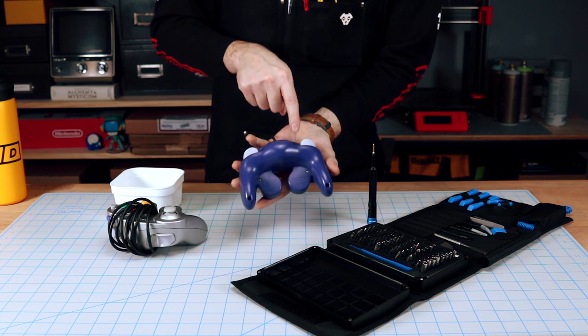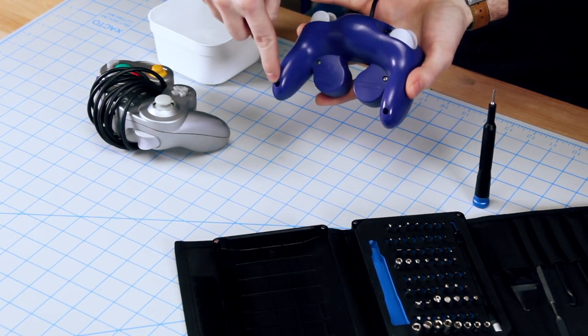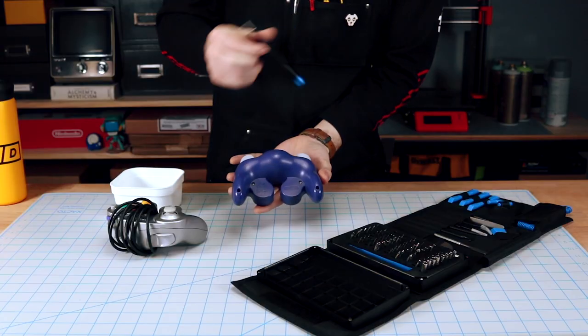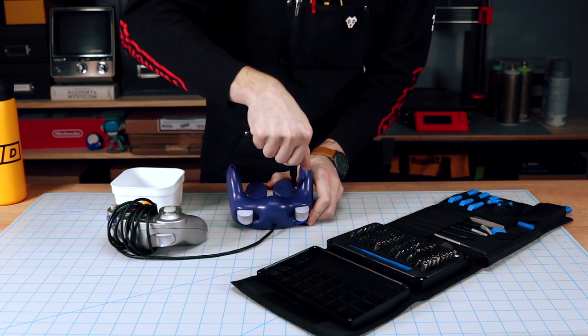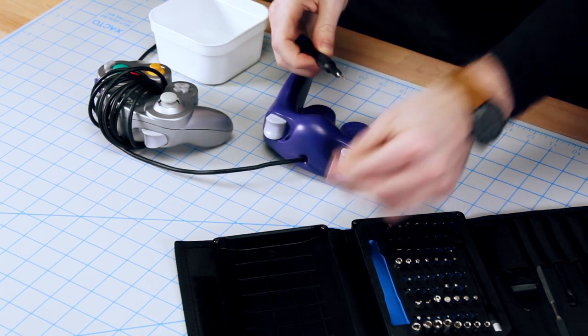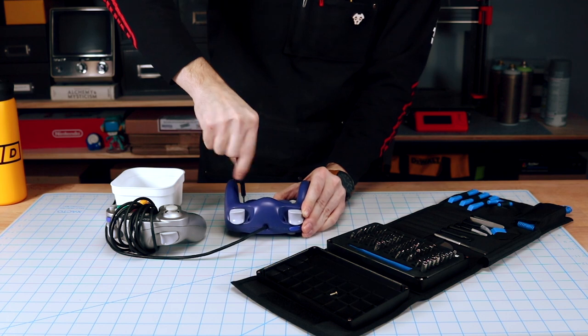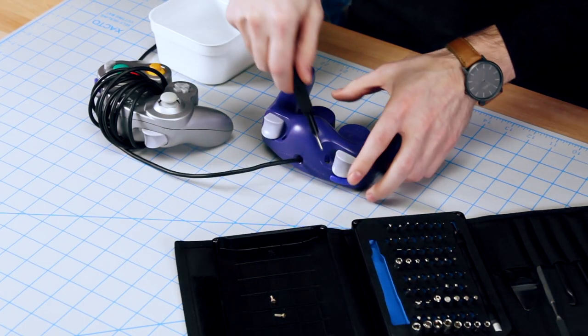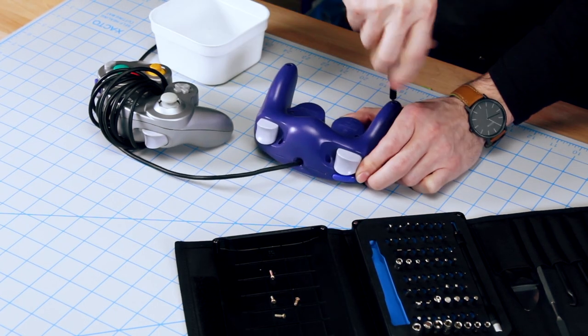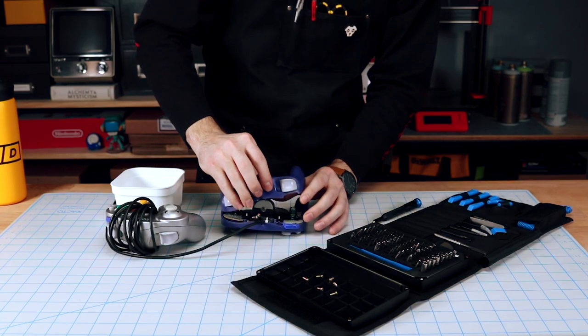So there are six screws on the back. You'll need a Y-shaped screwdriver to take these out. We're using this really nice iFixit kit. We'll have the link in the description below, but you can easily go with something cheaper. Once the screws are out, you can take the shell apart.